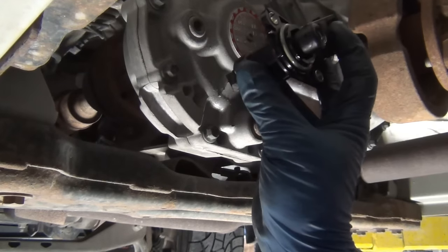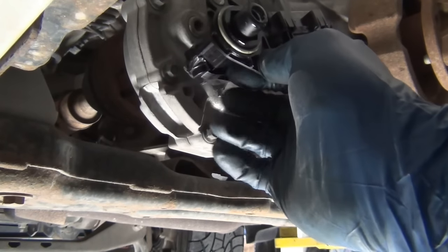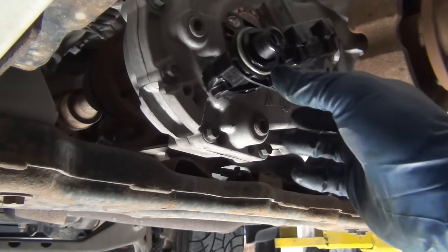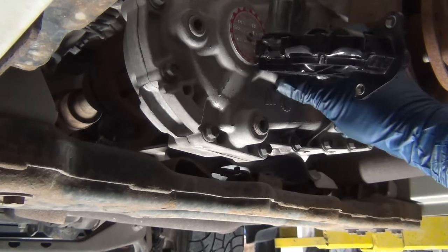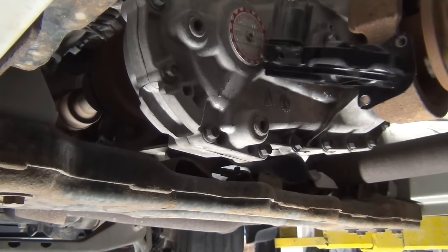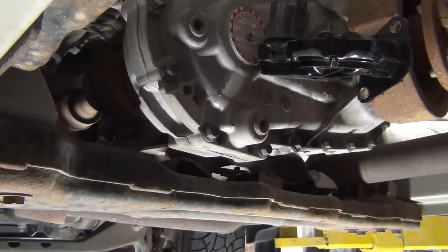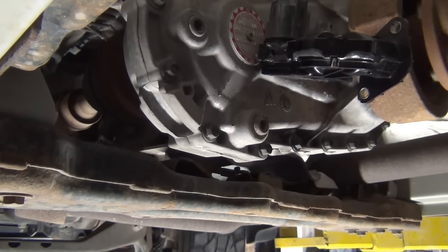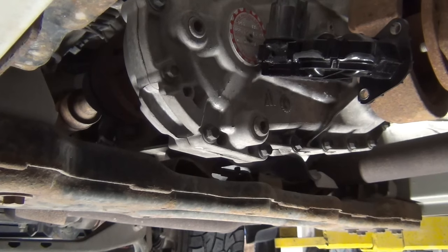So we are in two-wheel drive position. Fire it up, please. Put it in drive. There we go — clunk. Let out the brake. So we are in two-wheel drive. Hold the brake. So I push the button in. Let out the brake. Now we're in four-wheel drive — what happens if I just let go? It holds it. Push on the brake. Let out the brake. It didn't return. Brakes. Reverse. You hear it go pop — it popped back out. So that pop is a button in the back.